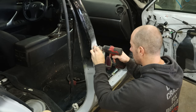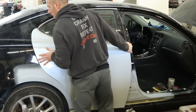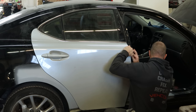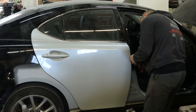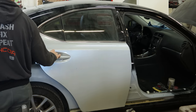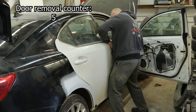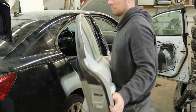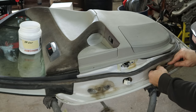I did the same thing on the bottom hinge and used the marks on it to line it back up. I'll do the same with the top, and that should put our hinges right back where they belong. Move them around a little bit and tighten them down, hopefully for the last time. I'll throw our door back up here just to make sure everything is lined up. Latch the back of the door, start our bolts, tighten them up, and the shoulders should line our door up where it belongs. Make sure it opens and closes and our gap looks nice.